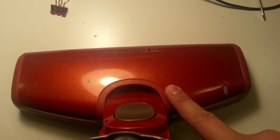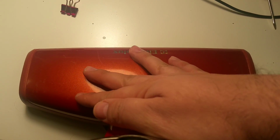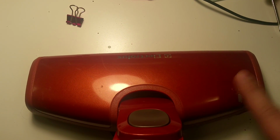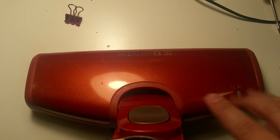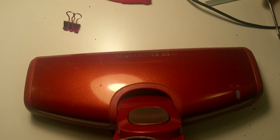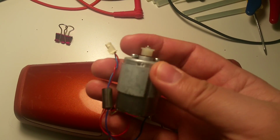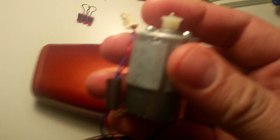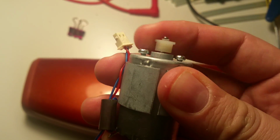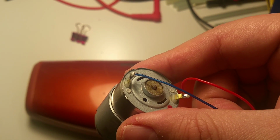Although you do have to get in there still. You can't just disconnect it and do that, because there's some circuitry on this end here, for the LED and stuff like that. Just bypass it completely. With this older model, it's a simple motor. It looks just like this right here. I got this out of probably an HP printer or something like that. It looks exactly like this, just with the teeth there, and it's just a little wheel, and it's essentially right in the end there and just spins away. So you just solder to these lines, and go from there.